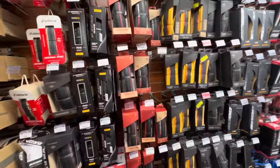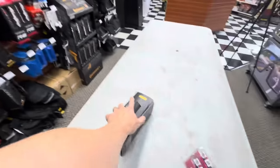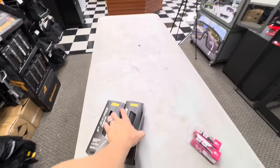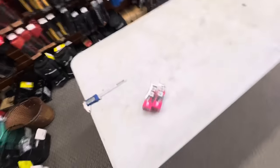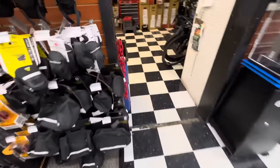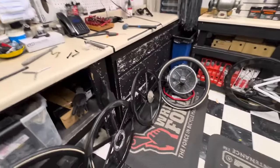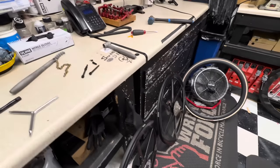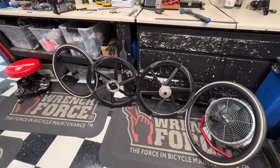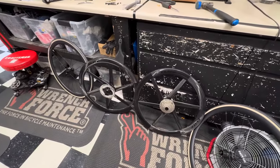While I pick out tires — I'll probably go with the Pirelli tires — one more thing about these six-spoke wheels: you don't have to worry about truing maintenance, which is great. But the downside is that if you do hit a bump and they go out of true for any reason, that's it — there's nothing you can do. I've sold one-piece mountain bike wheels and seen them go out of true for small reasons, and others that held true after a beating. There's no truing it, no replacing spokes — if they go out, you reach out to the manufacturer.